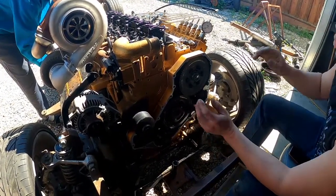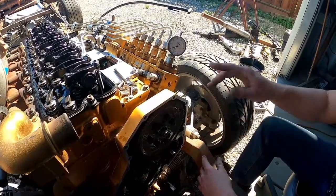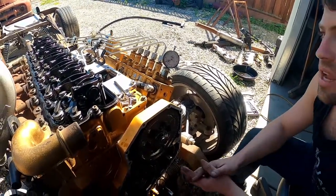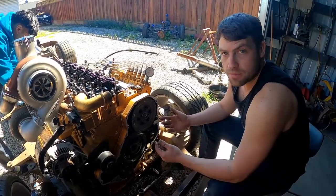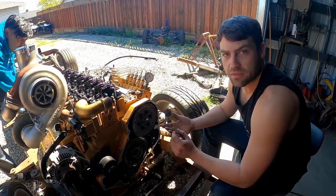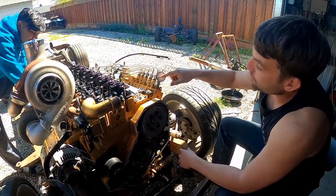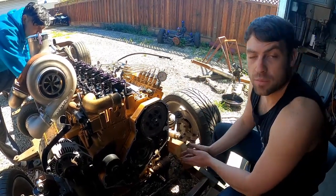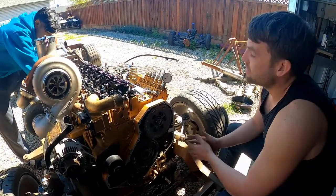You're going to rotate it while watching the dial indicator — that's why it's really important to have a helper. We're going to watch it rotate three full revolutions because we want to set our timing at 24 degrees. The chart for our P-pump calls for a setting of 0.3150. Watch this needle rotate three full times, and once it gets to zero the third time, watch it rotate to the 10 and then to the 15 mark. That'll be 0.3150, which puts us at 24 degrees timing.